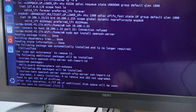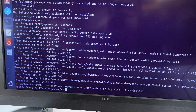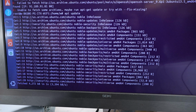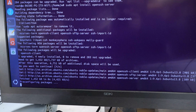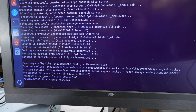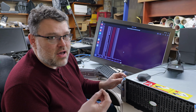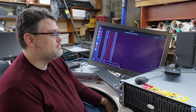Even though we don't have a fully redundant path with the 6 connections to the 2 controllers, we kind of do have a redundant path. Even though this chassis is not configured with the extra redundant path interface. Like, we should have that. It would be nice to have that. If we really wanted true full redundancy, we'd need the interface cards, but even in this configuration you do have a redundant path to each drive, at least part of the way.